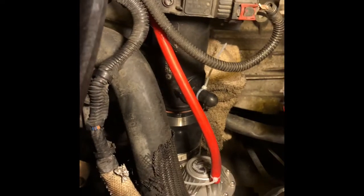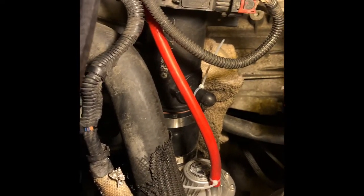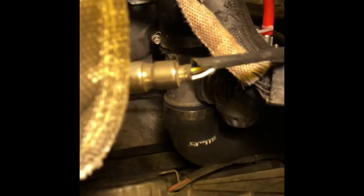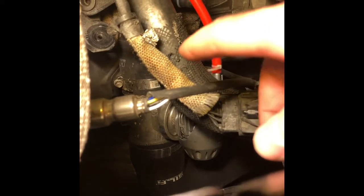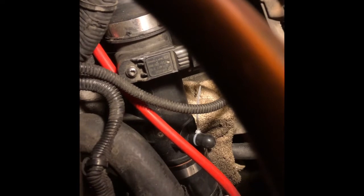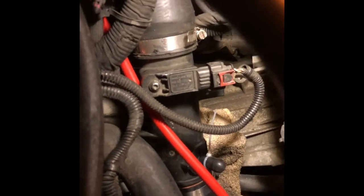The reason why I went with a 2.5, I believe, I'd have to double check and put it in the description, is that it goes into the intercooler piping that I already have, which is down here, the Silla Concepts intercooler. It already goes into it, so it fit nice and snug. The Silla Concepts intercooler piping actually runs with a stock charge pipe line, which is this one. It actually plugs right in there. So I basically just matched the size and bought a coupler or a silicone, what do you call this? Like intercooler couplers or whatnot.